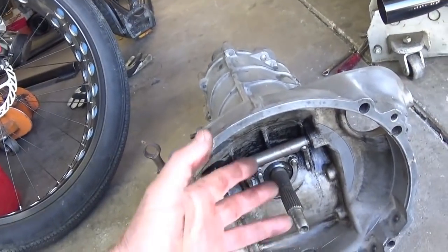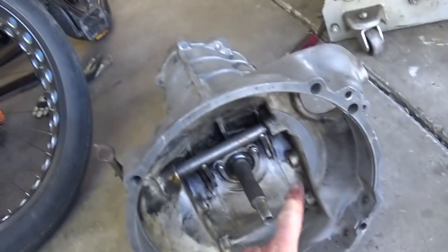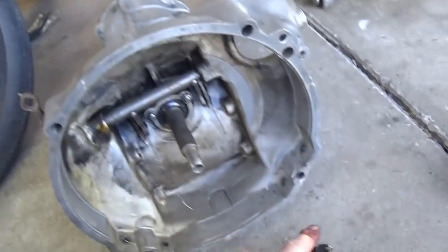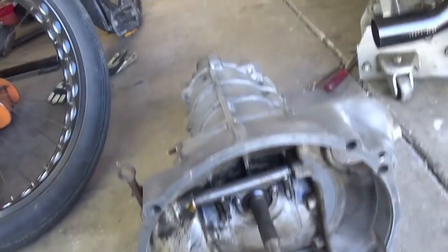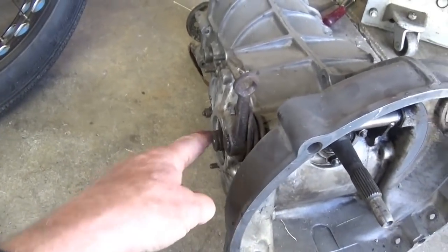The racers, you know, these didn't come out until the IRS trannies came out. And there are many IRS transmissions like the one that's in the car now that did not have this newer style throwout bearing setup. I'm really tempted to put some new axle seals. I know I got a coffee can around here with some flanges in it.